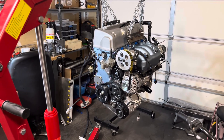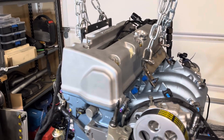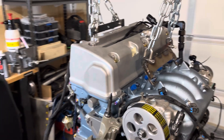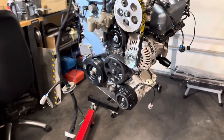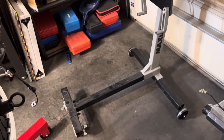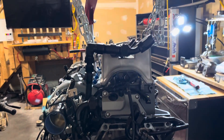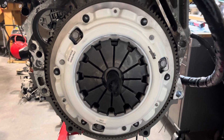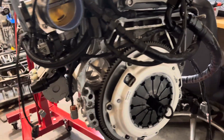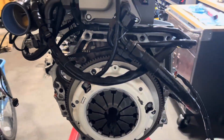In one of our previous videos, I built these lift jigs for K-Series, and they are making my life real easy right now. This engine is levitating nicely — just picked it right off the engine stand. Thing is totally level here dangling. And I was able to do my clutch and flywheel basically single-handed, counter-holding the crank. So this is going to be a real easy swap.